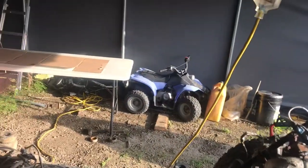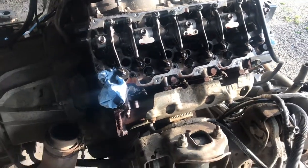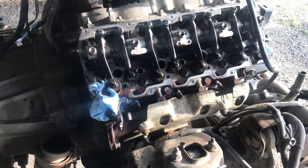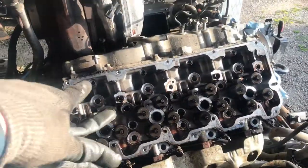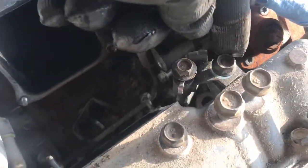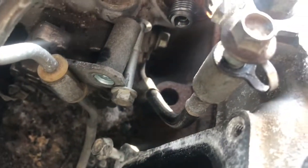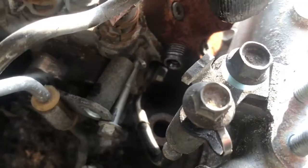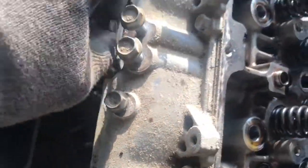We've got cardboard laid out — we're going to mark all the push rods as they come out and all the valve bridges, mark them all as they come off so they can go back in the same spot. Head bolts are all out, got the little bolts out. One thing I hadn't done yet — this bracket holds on the fuel line supply for the DPF injector, so pull that out and get this nut out of the way.